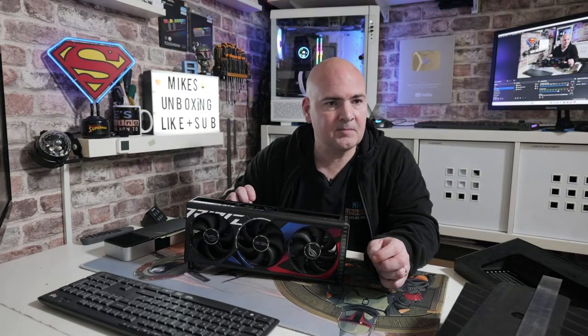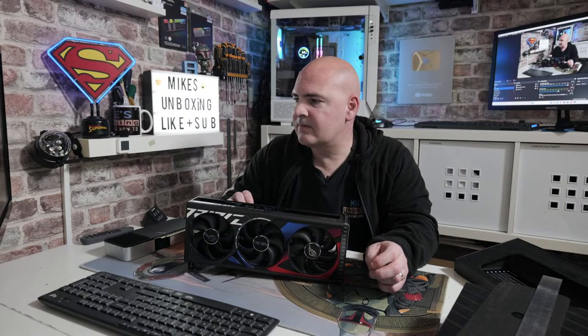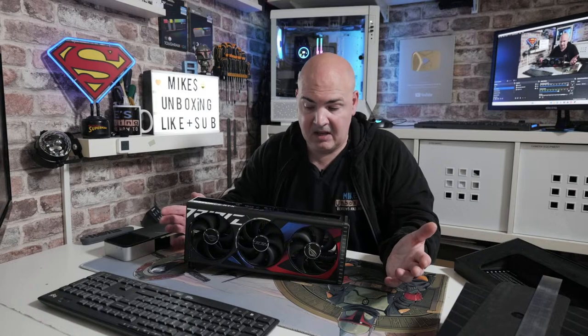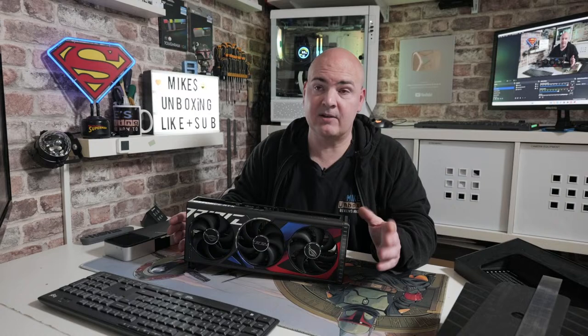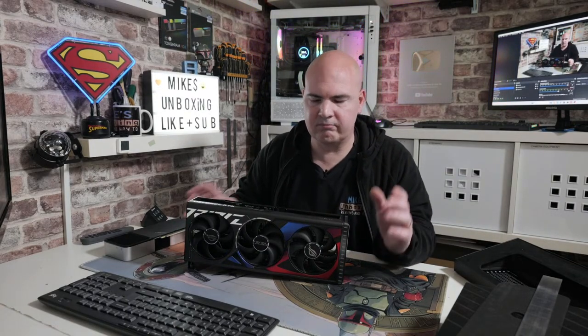Yes, Kath? It's a little bit off topic. Random guy, for productivity, what card should I go for, 4060 Ti or a 7700 XT? For productivity, it's hard to say. They're both very similar. If you're going for productivity, depends what productivity it is. If it's Adobe Premiere, NVIDIA cards all the way. I would argue that there isn't an AMD card which equals what an NVIDIA card can do due to the fact of that CUDA acceleration, which is far, far superior in Adobe Premiere, at least on the timeline. When it comes to just flat out rendering, not a huge amount between them, but yeah. If it's productivity, I think probably I would go NVIDIA.